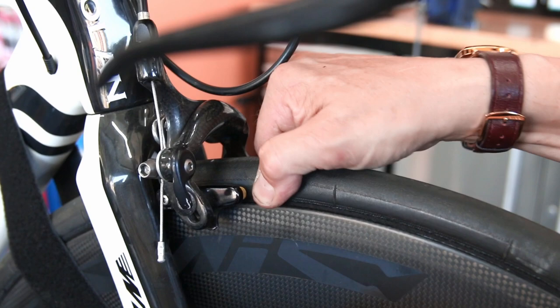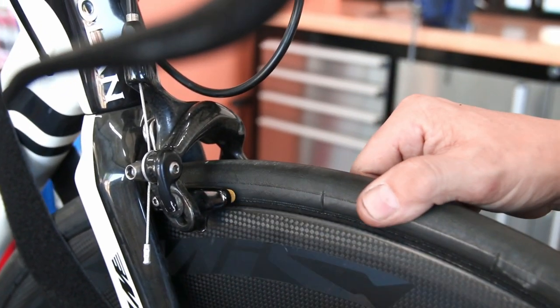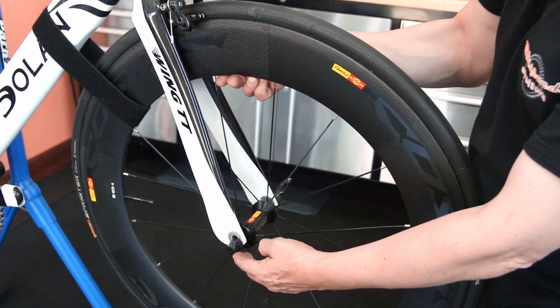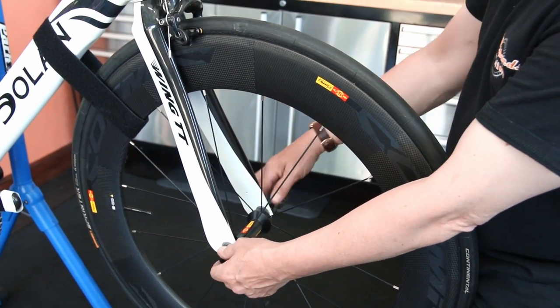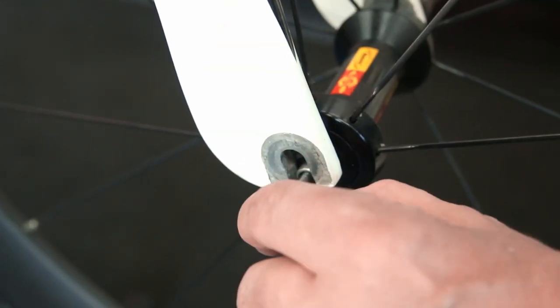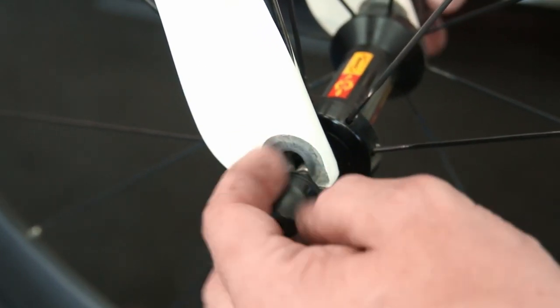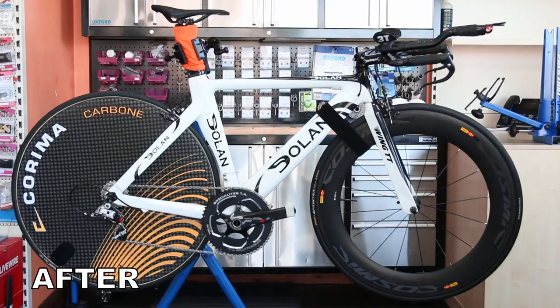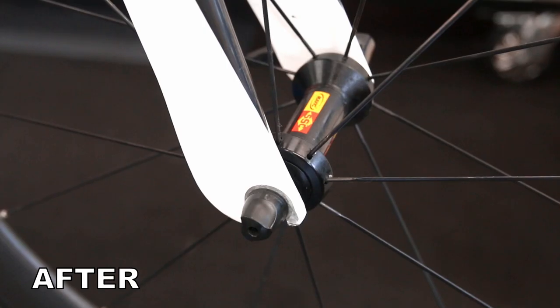These little spacers for the pedals fell out with the degreasing, which showed they were only stuck in with grease, so I just tape those in to let the customer know. Then this is something I see very often on a lot of wheels — a quick release skewer spring the wrong way around. It's narrow side in, wide side out. If you get the wide side in, it can actually stop a wheel going into the frame. I see that a lot. And this is our Dolan presented for the customer.